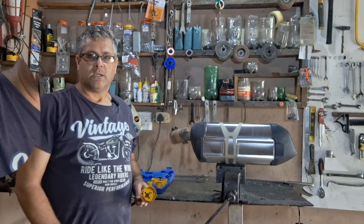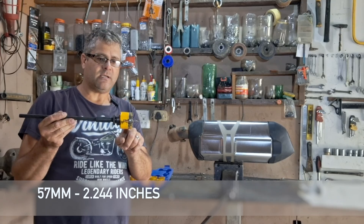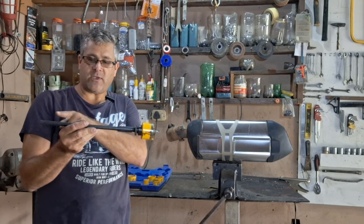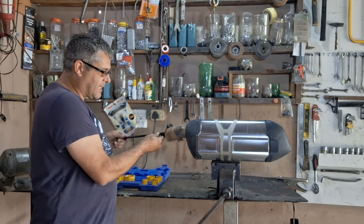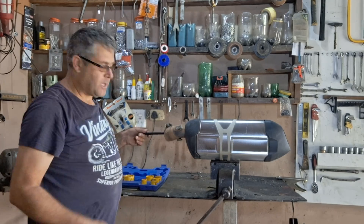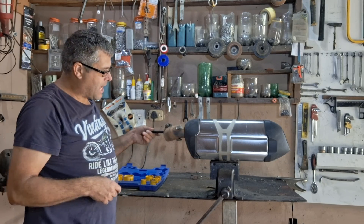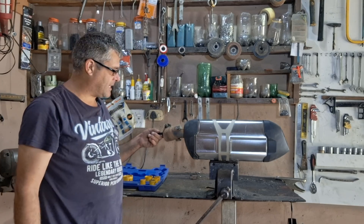Let me show you. Basically what I did is I took a 57 millimeter hole saw with an extension bit. By wiggling a bit, I can snake it through until I reached the end cap with a normal hand drill. I drilled through that end cap, so this pipe is straight through at this stage.